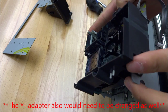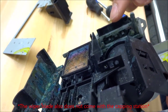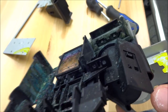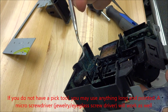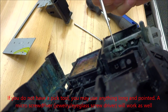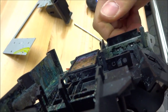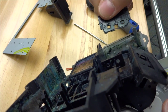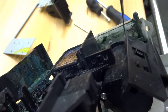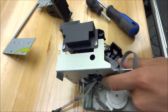We do need to change out the wiper blade, so we're going to take a look at that. Your old wiper blade has these hooks down here. I used a dental pick — you can use the hooked or the straight; for this one I'll use the straight. Basically you're going to dig in here and unhook that, then go into the second one and unhook that. Those are out and you can pull straight through. This is also a good way to clean off your wiper blade.